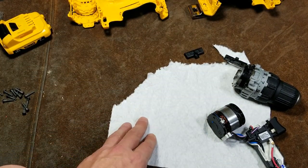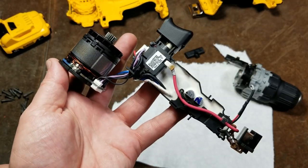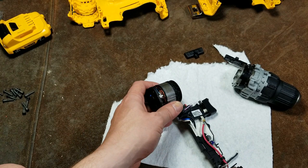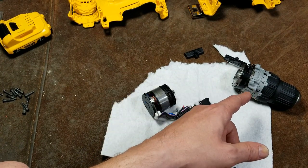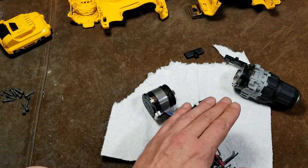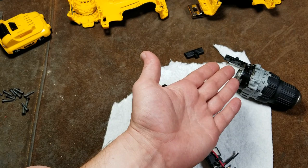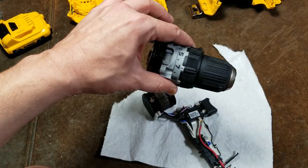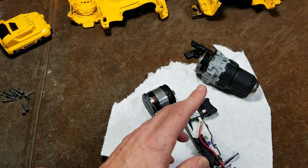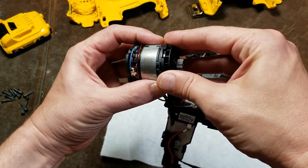The whole point is that they're putting a lot of grease in there because there's a lot of load on those gears. DeWalt is offering parts for this setup — they charge you about 60 or 45 bucks and you get a whole new gearbox assembly. What is nice is that at least manufacturers are starting to do that now. DeWalt provides a full breakdown of this gearbox — it is a 12-gear gearbox, four gears on each of the three stages.